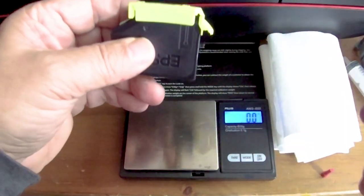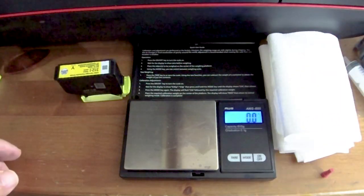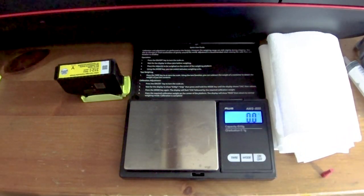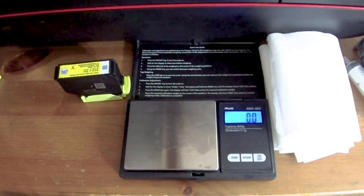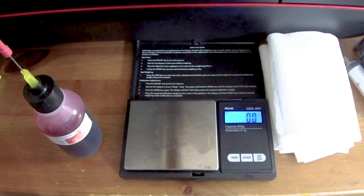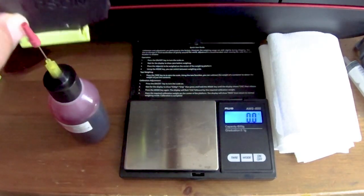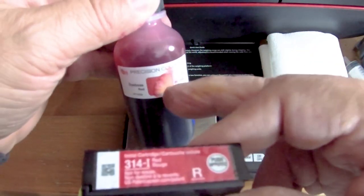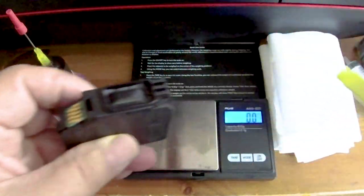Make sure the clip is on there tight. Now if you have extras of these you can just store them in this position and that will keep that exit port nice and wet. I think you saw the way I did this — there's no need to repeat it. Let's do the red cartridge and then we'll stop and discuss what we need to do to take advantage of this easy refillable process using your original cartridges. We've got our red — double check, red and red — and I can confirm it says dye-based red.